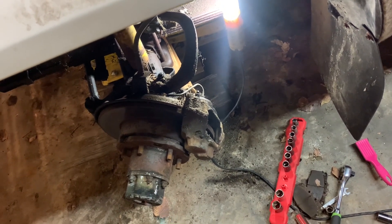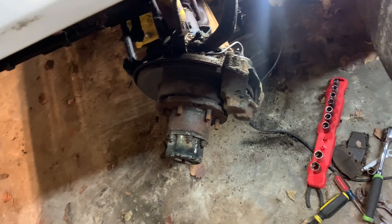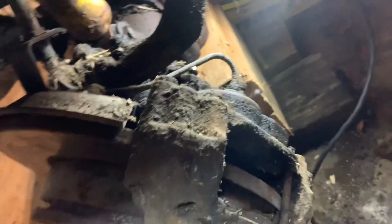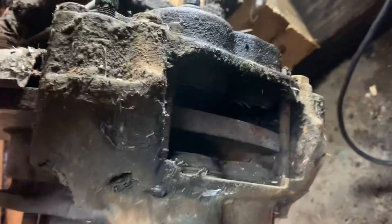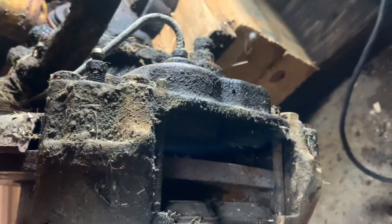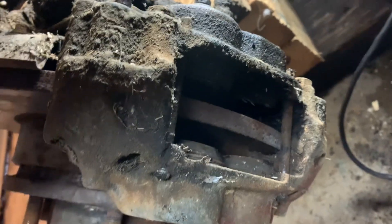So I'm going to go ahead and get these brakes - they just lock up tight, they won't come loose. I had to back the bleeder off, open it up, and then took a pry bar and pulled the brake pads apart. They're not that bad, but now what I'm going to do is take this caliper off, get these cylinders out, and put a rebuild kit in it because I don't trust it the way it is.